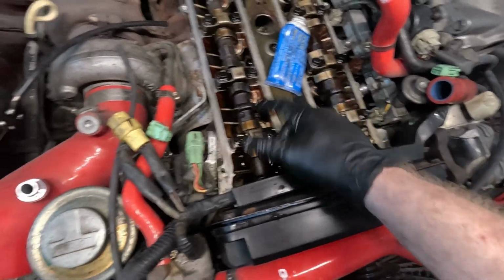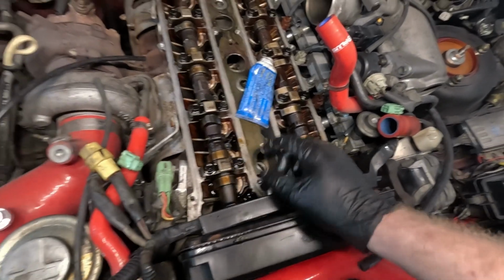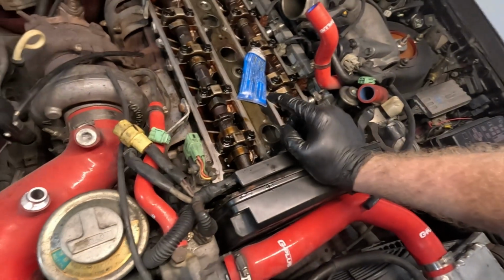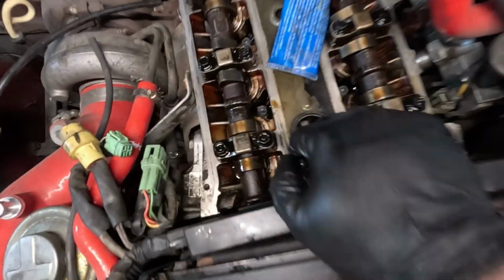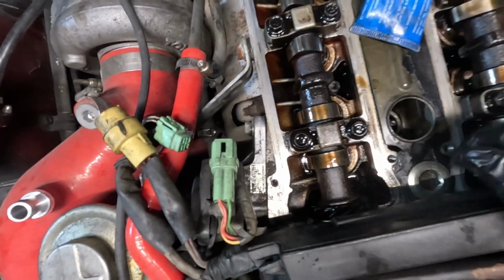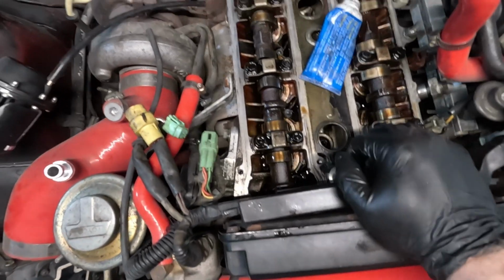Just a really quick pro tip. The second from the front set of head studs, there is a little trick to it. If you look, there is a little knob on these cams. If you rotate it straight up and down, it actually gets in the way of that head stud. Bolts are not a problem because they're a 13 millimeter 12 point. A 14 millimeter 12 point chrome socket is too big with this pointing basically straight up and down. So what I had to do, if you look really close, it's actually angled ever so slightly at the bottom. That way you can fit the 14 millimeter in there with the 3/8 inch extension straight up and down.